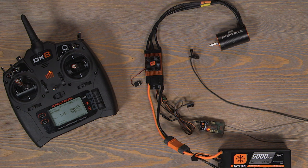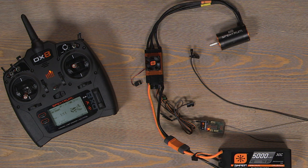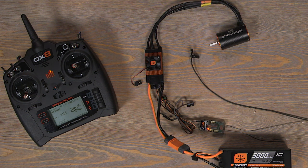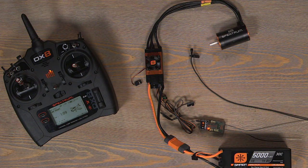Let's change the brake force. That's disabled at number one - one beep. Let's change it to level five. We're going to wait for one long tone and one short tone. That's the one long, so that's level four. And that's level five - confirmed accepted.